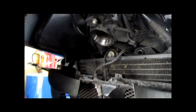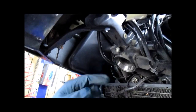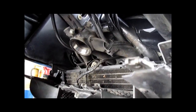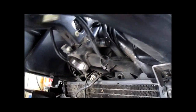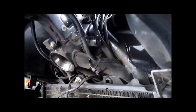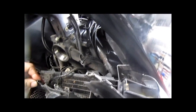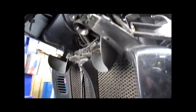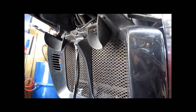Make sure it's seated up here in this ridge. Failure to seat that completely will result in what you think are properly adjusted steering head bearings when you first do this job, and then they will be very, very sloppy. Clip over there. They'll be very sloppy shortly thereafter because it's going to pound that lower race up into the steering head until it bottoms out. Usually, by the time that happens, the new bearings will be junk because the races will be indented from the roller on the bearing being loose.